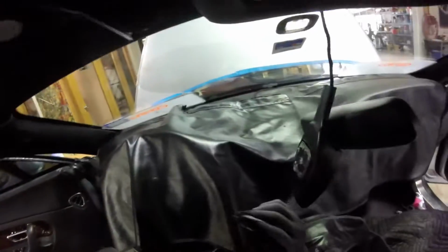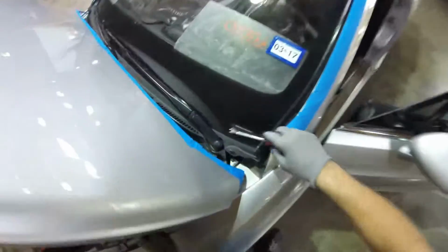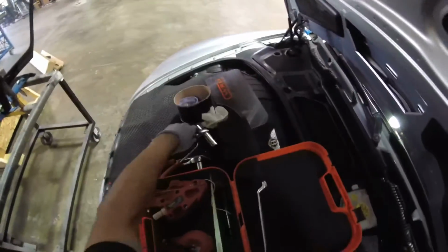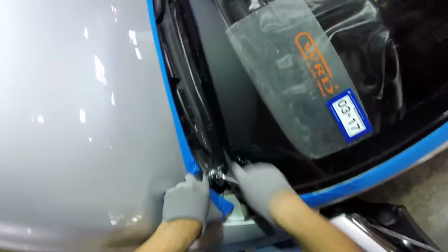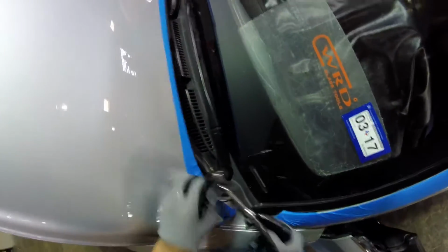Okay, so we're going to start working. I'm going to use my spider on this one, so it's not really heavy. It's probably 150, almost 200 pounds, but maybe 3 people can do it because the crane is over there, but it's a lot of work. Okay, so let's start here, guys. We're going to start stripping parts here. These moldings are probably attached with glue, urethane. We're going to start taking this one off with a 13 millimeter. Remember, protect the sides and edges of the parts.